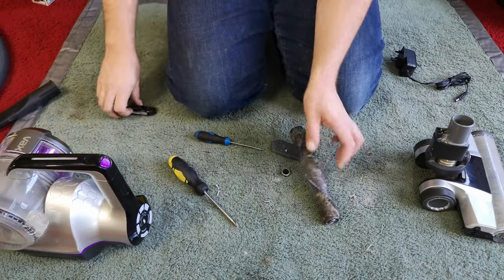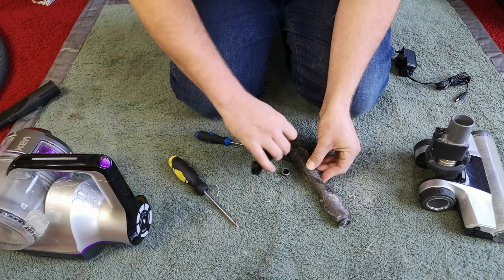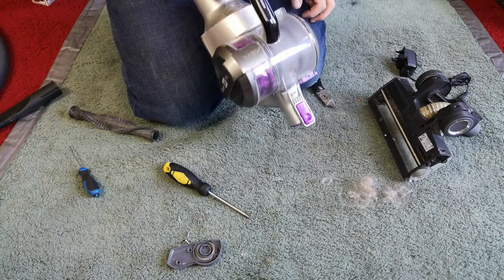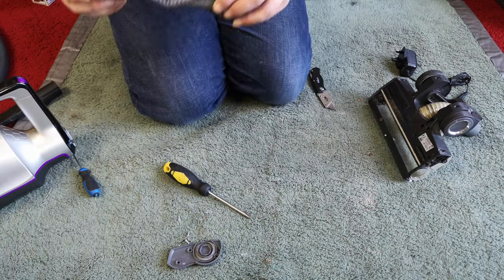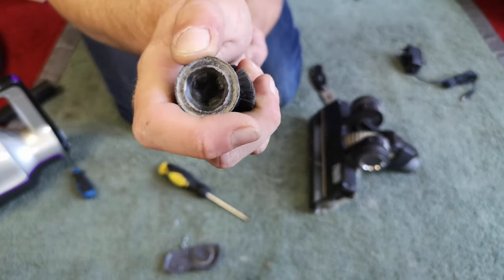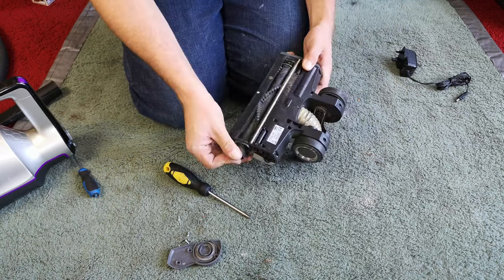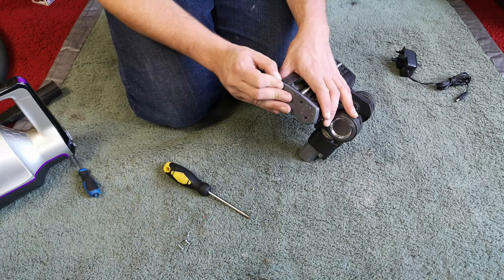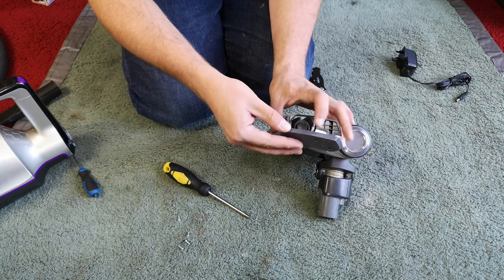You've got to get to brush rolls before they melt the upright — these are terrible for it. Just get left and all the hair melts the soft plastic and destroys the thing. You can get access to clean in there, and we can get to our brush roller. The bearings sit under this cap. Get all of the dirt out of there. I'm going to get this cleaned up so it's looking better. Then you've got to line up the little end cog with the hex and that will hold everything into place.